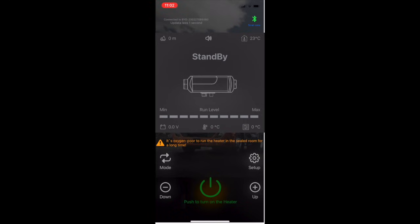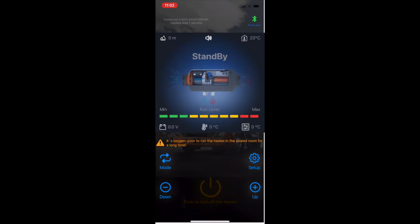I'm going to power it on by pressing and holding the power button. It says 'start heating' on the controller in the truck and 'ignition' on the screen here. It takes a couple of minutes to fire up, and while it's firing up you'll notice the voltage drop is quite significant. The battery isn't great in my truck and it draws quite a bit of amperage for the glow plug while starting, but once it's in operation the voltage will jump back up again.